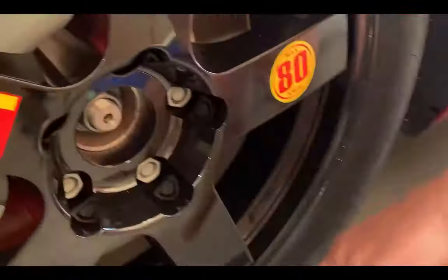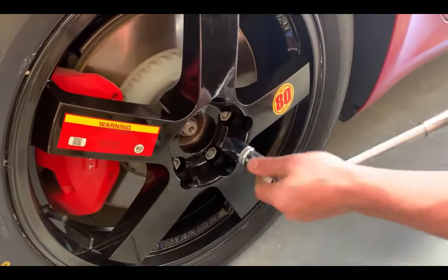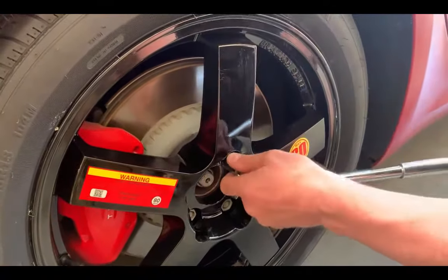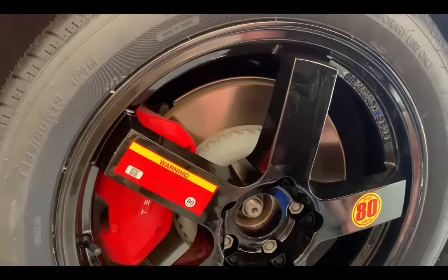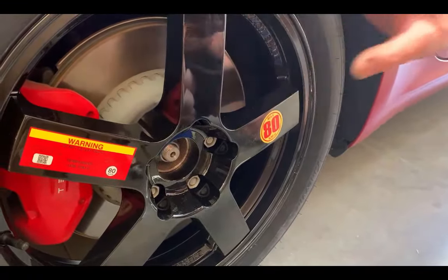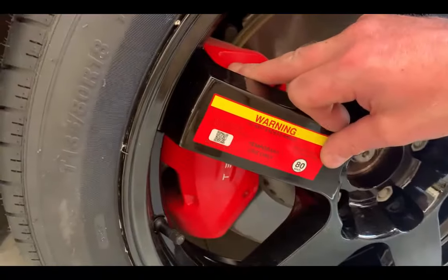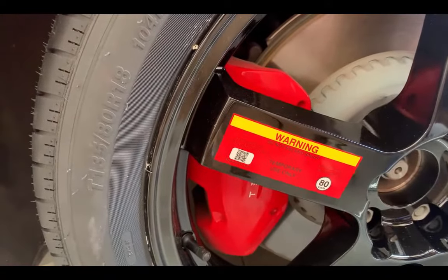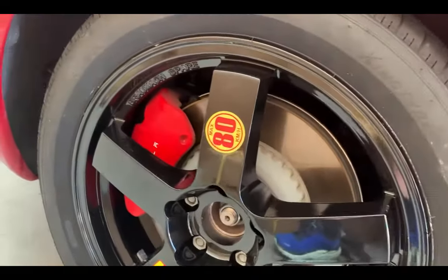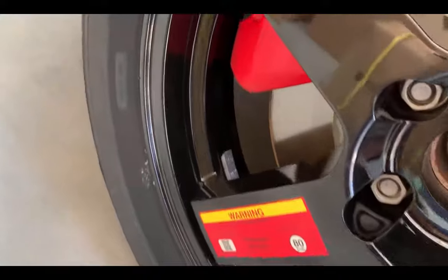The wheel now has the weight of the car on it and the car is in park. Go around and tension the wheel nuts - one, two, three, four, five. We're done. The process is exactly the same for the front wheel - there is no difference at all. The wheel will definitely fit all models. You can see here this is a Model 3 Performance - even with the wheel weights it's tight but it does fit. The calipers on the Model 3 Performance are actually the same calipers fitted to the Model Y.